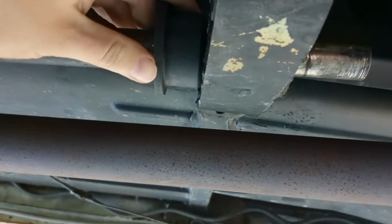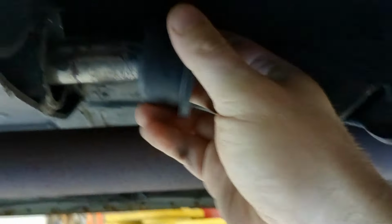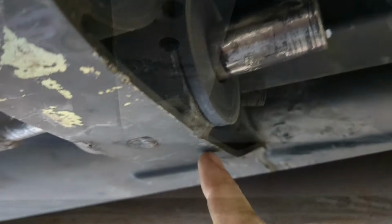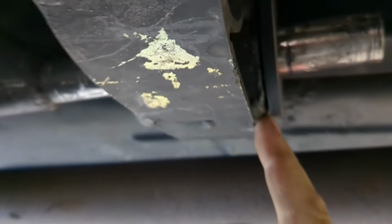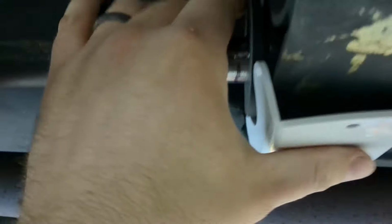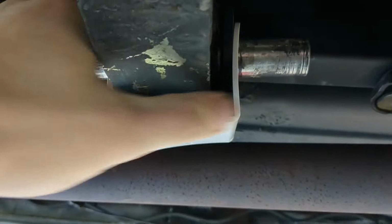I split this one so that you could get it on there. And this one. Alright, this is gonna be a problem I didn't notice before. That sleeve is a little bit wider than this strap, and the bushings were like perfect for that strap, so I'll bet you it's a little tight. Yeah, she's a little tight. And 1/4 inch steel ain't gonna bend like that either, so I'm gonna have to add some width to that inside dimension here.